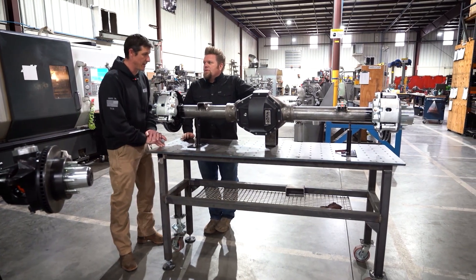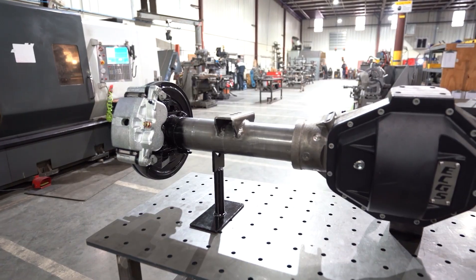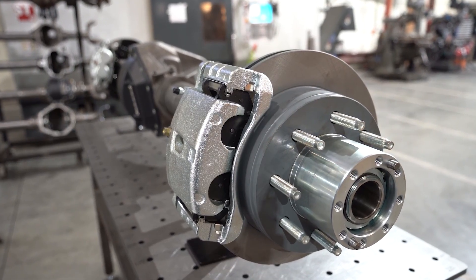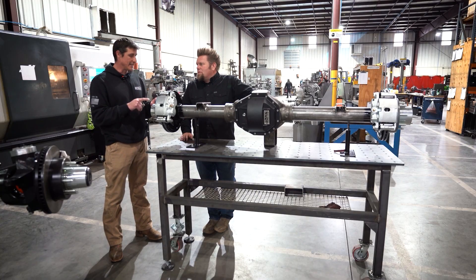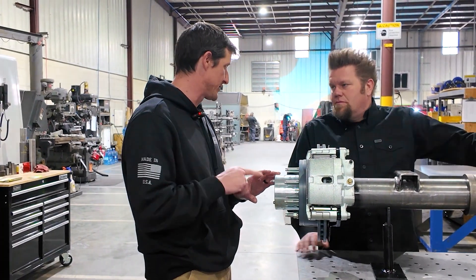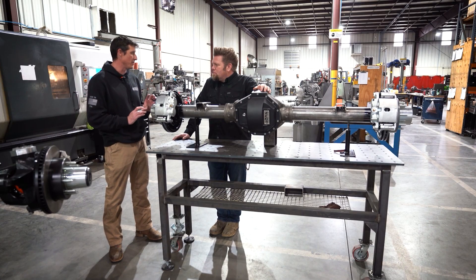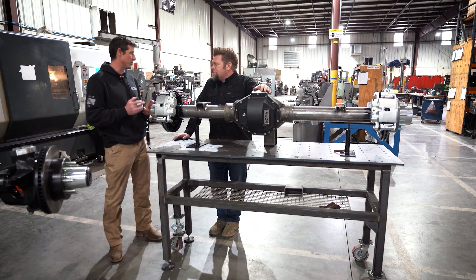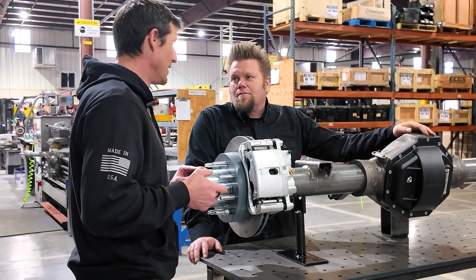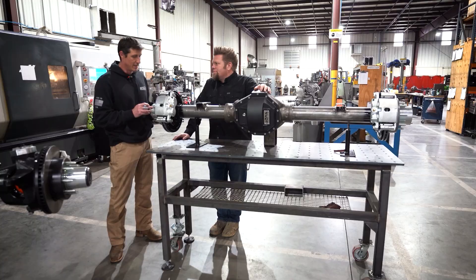This is a great buggy option because of the ground clearance, the strength, four-inch tube, 40 spline spindle, and wheel hub bolt-in 40 spline shafts. We've got dowels here. A lot of times people build 14 bolts and you'll have your axle shaft bolts come loose. To solve that, we use a larger mounting pattern for the flange, which gives you better clamping force. Plus we put two dowels, so when you put this shaft in, the shaft actually presses on the dowels — so you don't get any of that wiggle in the shaft that will try to break it loose. When you're running a spool and big tires, it puts a lot of stress on the clamping force of the shaft, so the dowels will keep your bolts tight.